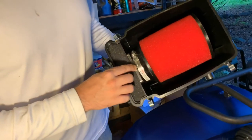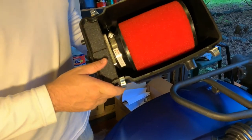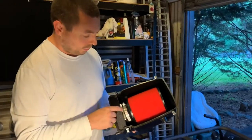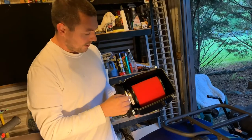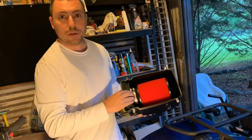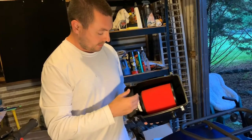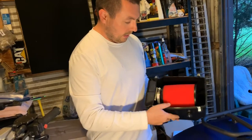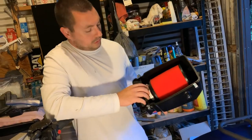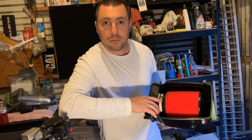The main thing it does is mimic what some other manufacturers do — mainly similar to what Honda does from the factory, where they have a foam filter cylinder shape with a hose clamp that positively seals it to the flange it mounts to. There's no way for dust to get by because you can tighten it up. I really don't understand why Yamaha couldn't have just done this from the factory to begin with.